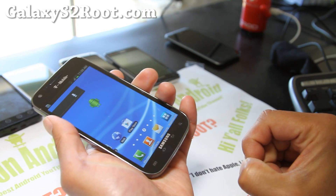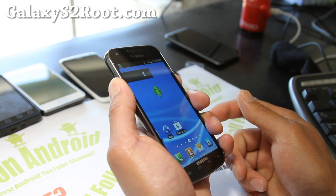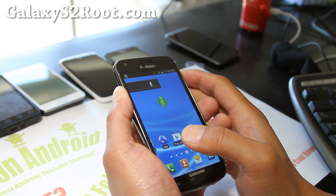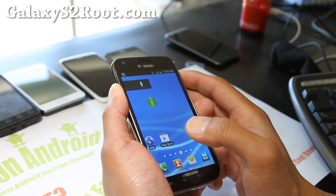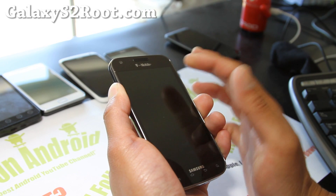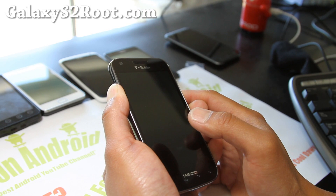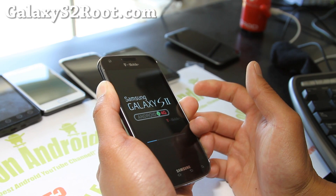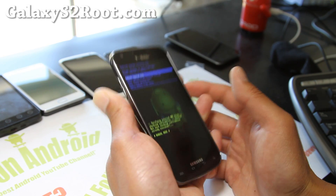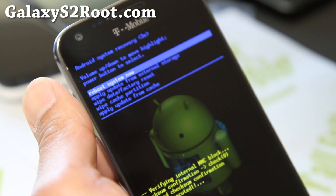If you're having problems, just do a factory reset. Hold down — take the micro USB cable out first, otherwise you'll end up in download mode. It's the same button combo: volume up, volume down, and the power button. Hold them down until you get into stock recovery. Let go of the power button when you feel the vibration of the phone rebooting. If you keep holding, you'll get into stock recovery.